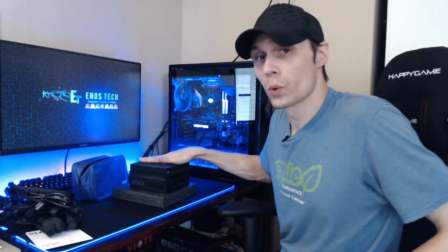The fan specs, like I said, is a 120 millimeter fan by 25 millimeters deep. Its speed is 0 to 2200 RPM, give or take 10%. Airflow 73.9 CFM. Noise levels is 32.3 dBA. It's a fluid dynamic bearing. Its energy efficiency is 80 plus gold, which is really what you want to be looking for if you're going to be building a powerful gaming system. It's just good to have something solid in there powering your system. You don't want a ticking time bomb for a power supply.